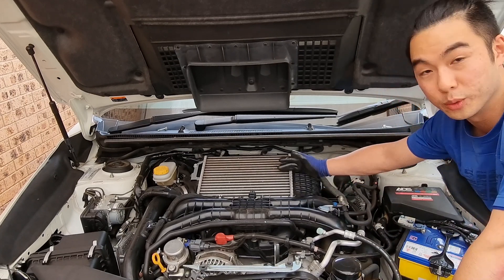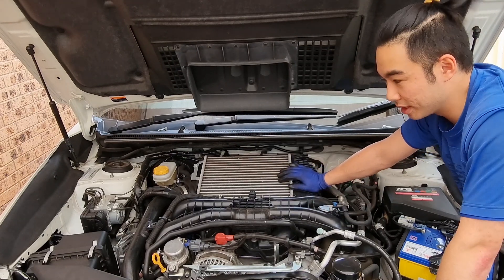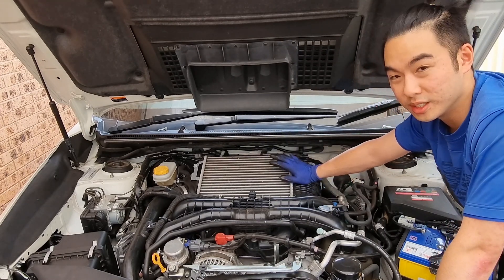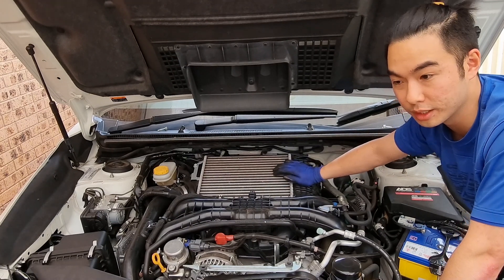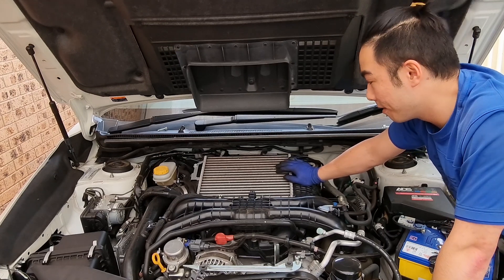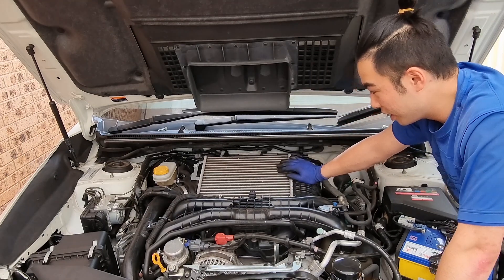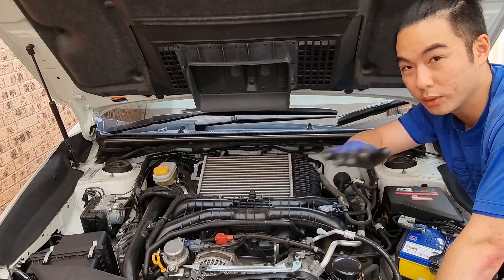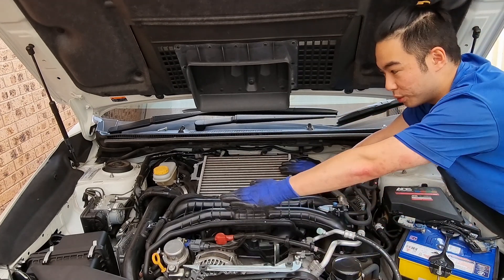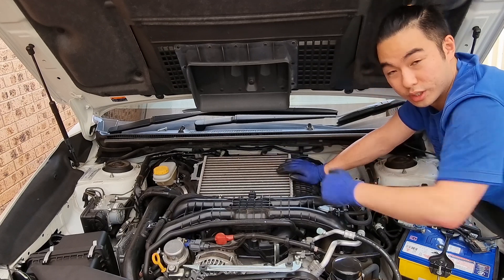The hot air has nowhere to go because the intercooler is covering the top. So the elements at the top of the engine bay start to heat soak. And this being metal, it starts to soak the heat. Because this is so thin and so small, there's a very small surface area for the heat to soak, and this happens pretty quickly. After about 40 to 50 minutes, I've noticed that this car starts to suffer from heat. The idea of the vertical one is to allow air to go through and escape through the back very efficiently. The air comes straight through here and hits the intercooler to cool the air before it goes to the engine.